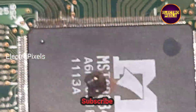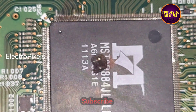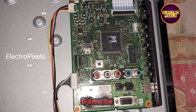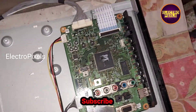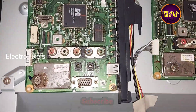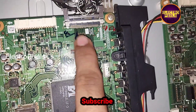This complaint is because of lightning damage. Instead of installing a universal LCD/LED motherboard, I took another Toshiba motherboard from a 32 inch LED TV to use as a replacement.